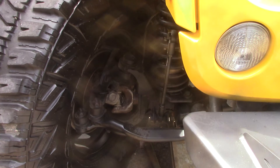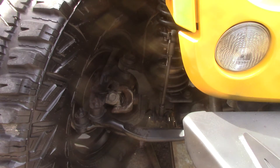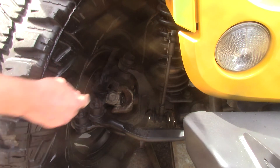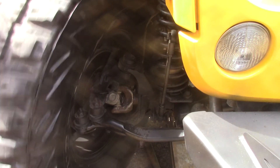You got your old central axle disconnect on your Dodge or your old Jeep? So what? Stub shafts and the U-joints are still turning. That's what's wearing everything out and giving you the vibration — that stuff turning all the time. Locking hubs is the only thing that completely disconnects the hub from the axles.